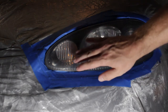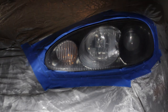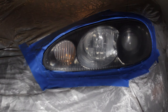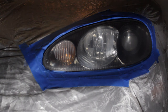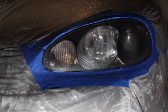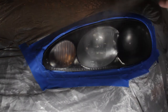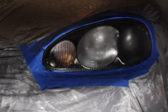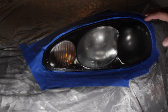After all our sanding, look how clear this headlight already is. Before we lay down the clear coat, go ahead and hit it with some isopropyl alcohol. Shake your can really well and make sure the temperature is right in the area where you're painting — not too cold. I prefer very light coats with clear coats. We're going to put three coats down, wait a couple minutes between each layer. Any kind of run at this point would be horrible, so I'd rather do a series of very light coats than rush it and have to undo a mistake.